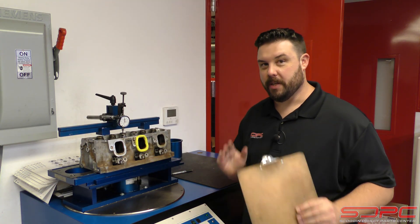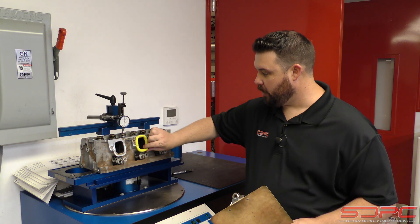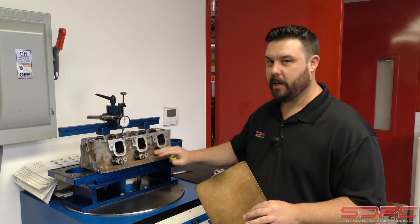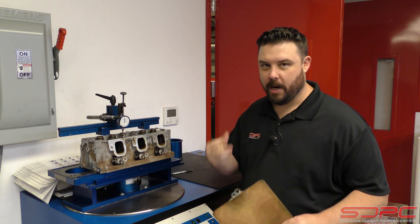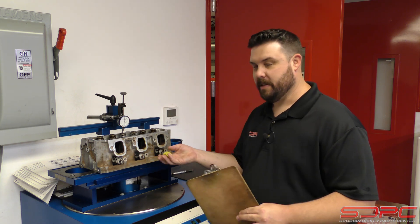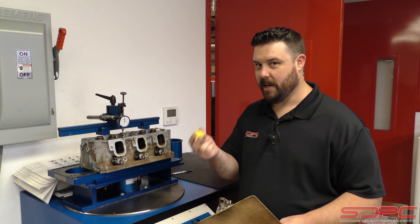We finally finished on the exhaust side after doing the intake side. To answer a couple of questions we know people are inevitably going to ask: what is this over the intake port? Well, it's just clay — I actually molded it myself. A lot of people ask why do you do that. It's to help keep turbulent airflow from coming around the sharp edge here. You have an intake manifold, you have a port here, you have a throttle body, intake and air filter — they don't have any sharp edges like this in the design. This kind of helps keep the airflow consistent when you're measuring it, but it also just helps give you a realistic view of what it is flowing. Some people say this is cheating because it's helping — it doesn't help, it just keeps you from hurting your results. That is actually the key.